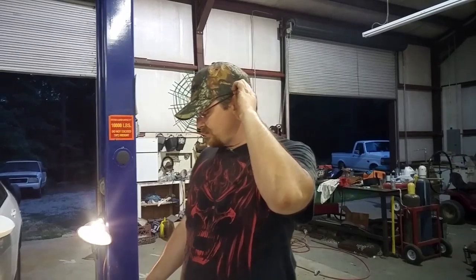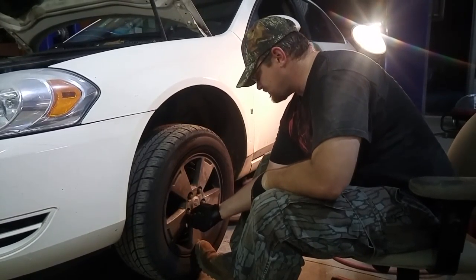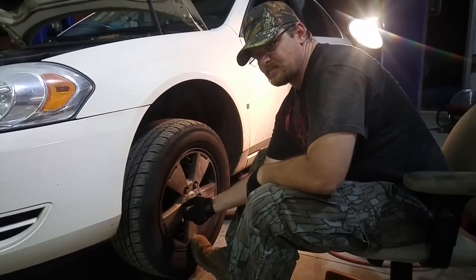You need, on this particular car, a half inch socket, some kind of clamp, and a tire iron. Now for this video, I'm going to use the lift and pneumatic impact wrench just for convenience. But that's all you need, and it's actually a simple process, so I'm going to show you guys that right now. I went ahead and loosened up all the lug nuts. That's your first step.